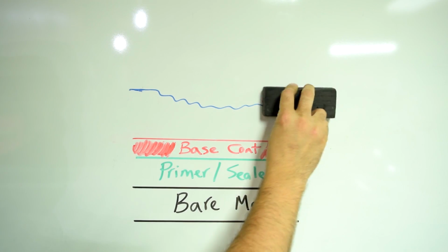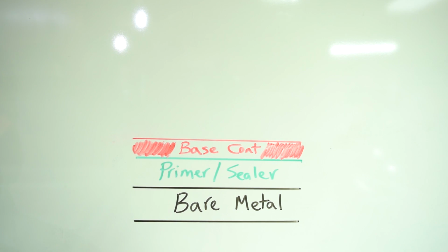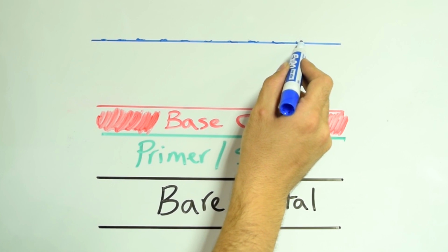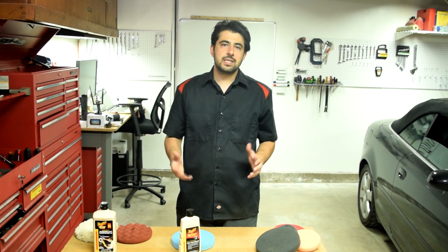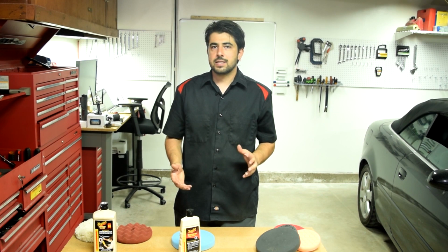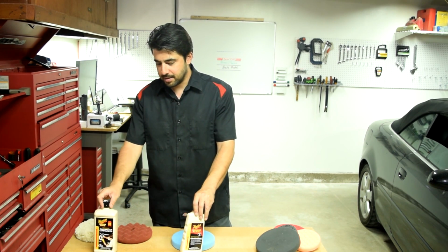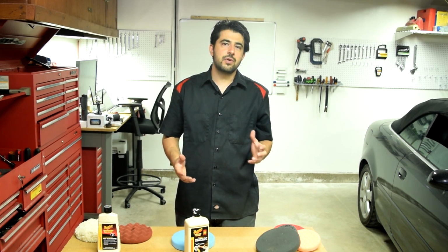All right, so after using your polishing pad and polishing compound, you would get rid of the surface that looks like this and replace it with a much smoother looking and polished surface, but there are still some blemishes on the surface, which are basically called swirl marks, which are very tiny scratches on your clear coat that still remain. Now, these could result because maybe you swapped the compounds around and used them with the wrong pad, or if you use the rotary polisher.